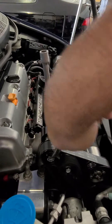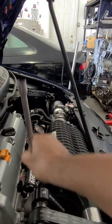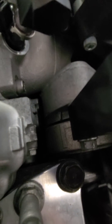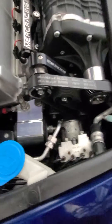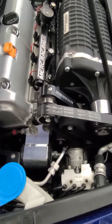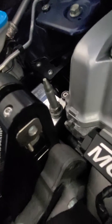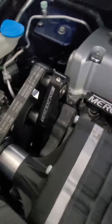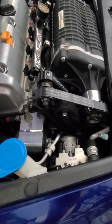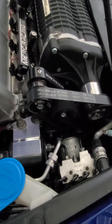After that, retighten your bolt, move everything out of the way, and verify — start the car up and recheck. Belts do expand a little bit over time. My pulley combination is different than everybody else's, but as long as you have the right belt, you should have enough play to go up and down. Currently my belt is adjusted properly, nothing is broken, and I will not have any belt slip.